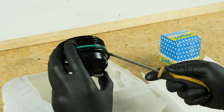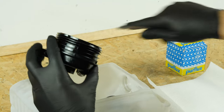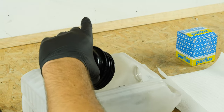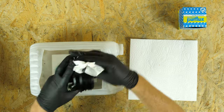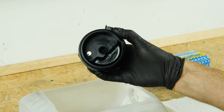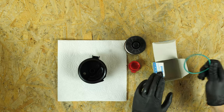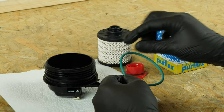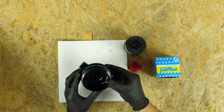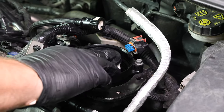Then remove the rubber O-ring from the cover. Clean the filter cartridge as well as the cover using a brake cleaner fluid and a piece of tissue. Get the new filter. Oil the joint of the cover and put it in place on the cover. Insert the new filter element, pushing downwards to the bottom of the box.